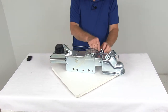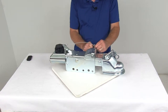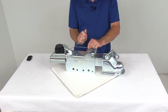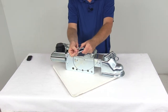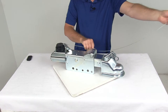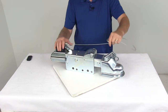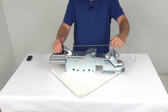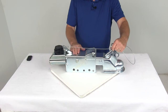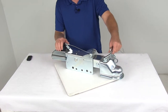It also comes with a standard breakaway kit, which is included. You have your cable, and on the end is a carabiner hook that will attach to your tow vehicle, and the other end is attached to this lever. So if the trailer ever comes detached from the tow vehicle, it will pull on this cable, which will activate the lever, and that will activate the brakes on the trailer to prevent a runaway situation.